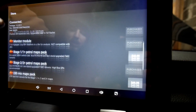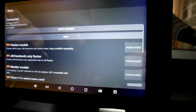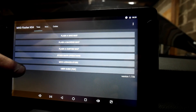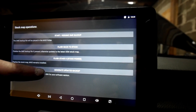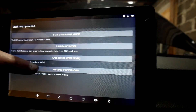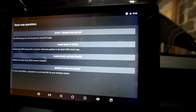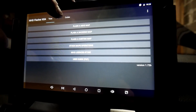What you're going to want to do is download the JB4 backend flash flasher — that's literally all you need, because all you're doing is a JB4 backend flash. Next, go to stock map operations and generate an updated backup. I'm not going to do it since I don't need it, but you would generate a backup map and it's going to save all your last preferences just in case something goes wrong.